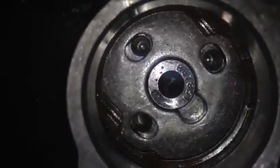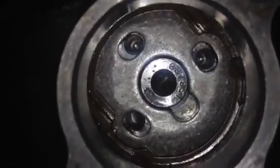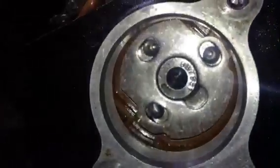We're going to put in the cam bolts, and that's where you fine tune it — a little bit left, a little bit right. And then you can also see there are our marks. One of them is a little bit higher, so when we do put the tensioner on, the chain will snap into position and it's going to pull it straight.